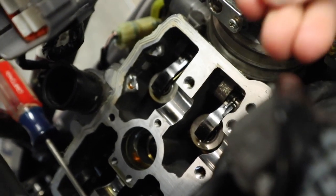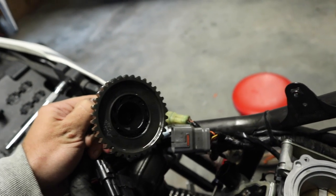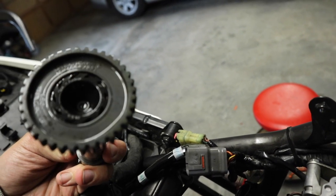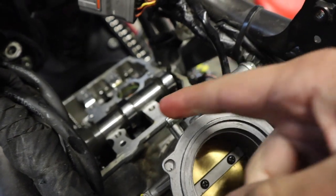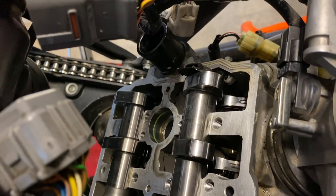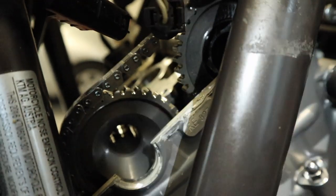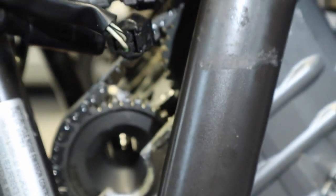I'm just going to lift up here on the arm and put the correct shim in on each side. That's what it looks like with the shim in place. We're going to start with the intake camshaft — at least on the rear cylinder, it goes up front here. We're going to get this down in place, and by putting it in we're also going to run the chain around the gears. You can see I've got the intake camshaft back in. I went ahead and lined up the mark on it so it's at the right position. Make sure when working on the rear cylinder you get this little plastic piece reoriented on the end of the camshaft on the intake side — the open part should be pointing up. You should be able to see the timing marks lined up flush with the top of the cylinder head.